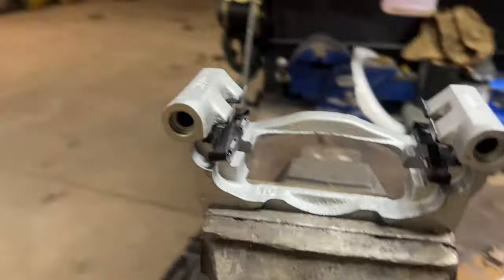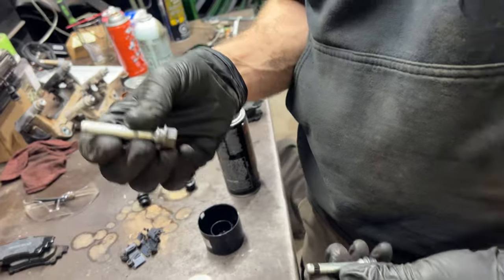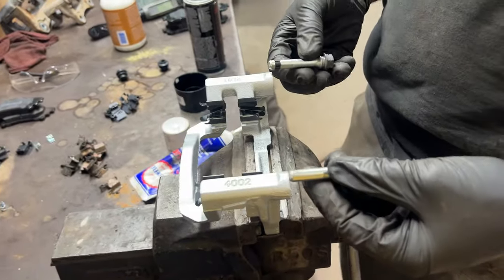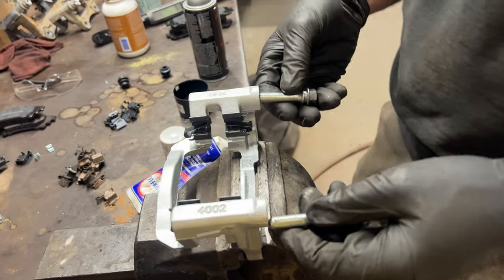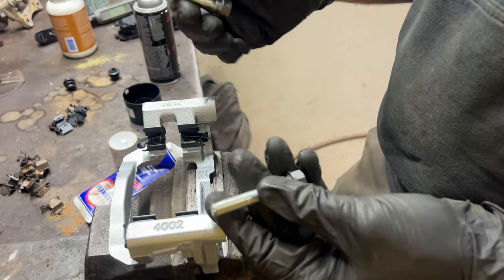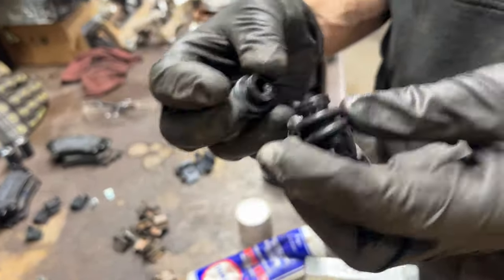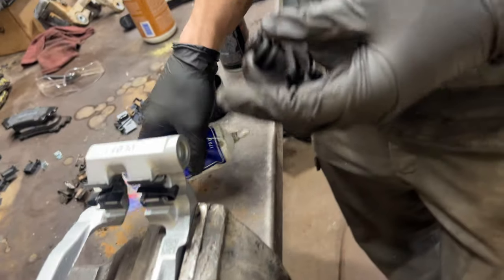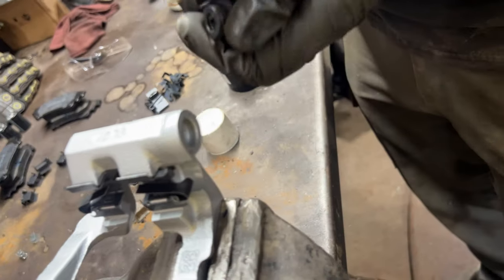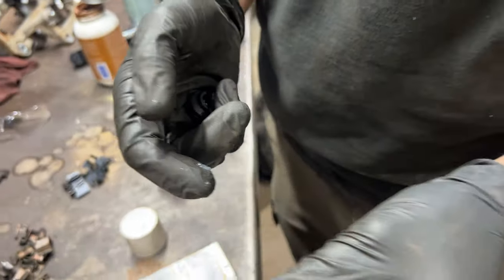There is a difference in these pins. Although they are the same length, one has a rubber and one does not. It is important to note which side they come out of, as they vary from side to side. On this van in particular, on the driver's side, the rubber comes out of the right side bore — very important. We've reconditioned our rubbers, nice and clean. I'm just going to put a little bit of lube on the inside where it seats against, to help keep any moisture from intruding into the bore and to aid in installation.